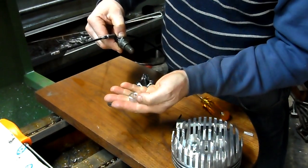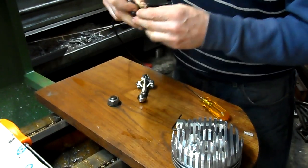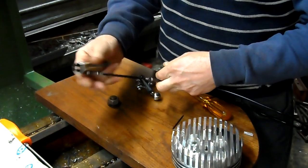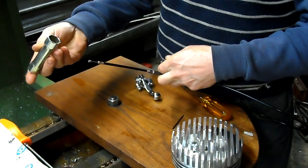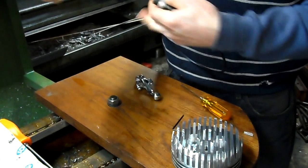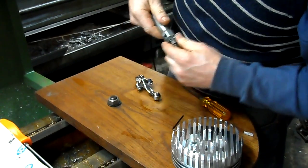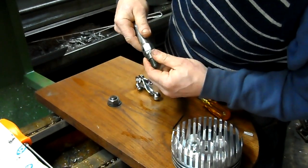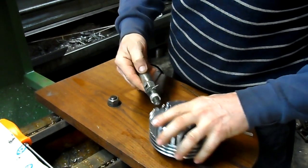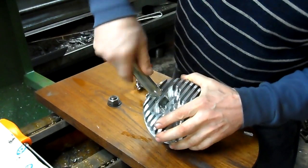This little aluminum spacer comes with the kit. This is the spacer that spaces the valve to the appropriate distance. What we use is this spark plug socket — I actually like the ones that came originally with your little China Girl engine kits, it's sheet metal and it fits. You just slip it over the cable. You can only install it just a little ways because it'll hit the set screw, but that's okay — it's got enough bite onto the hex to torque. Put the spacer on. And there we are — screwing it in.